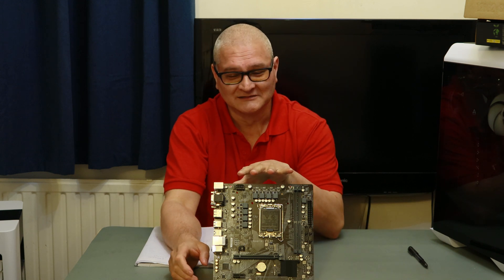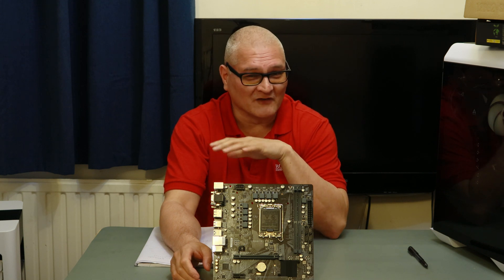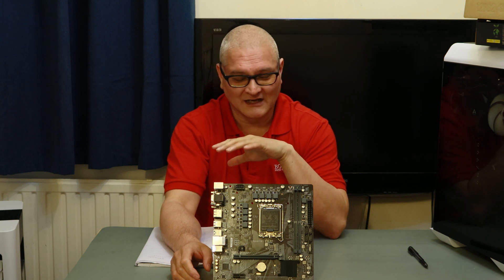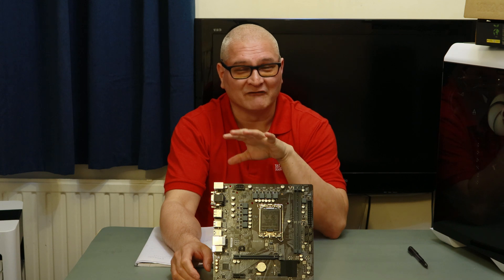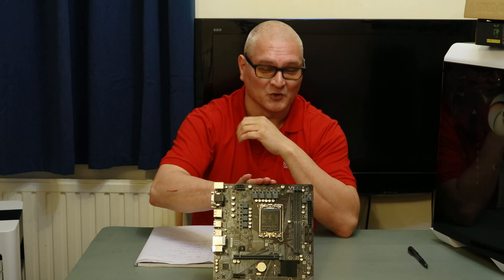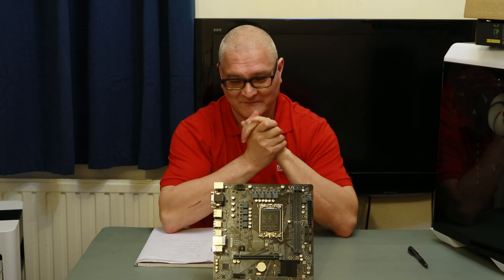I'm not going to put a 3080 in here — it's not going to be stable enough and I wouldn't even go there. I also wouldn't go over a 12600K — that's pushing it. The 12500 would be no problem, the 12600 might be okay, but the board hasn't got enough stability or voltage regulation, and there's no adequate cooling to keep up with a high-end processor. So don't buy this budget board, or any budget board, and put in a high-end i7 or i9 — it just won't work. Stay with i3s and i5s.